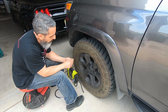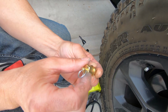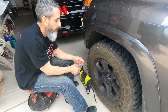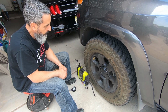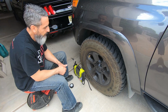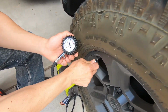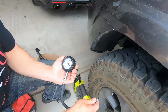So I'm going to loosen that set screw again. I'm actually going to turn it the half revolution. I'm thinking that's going to take me down to a little over 19. And then I'm going to turn it another quarter. I'll snug up the set screw, and let's see where we're at here. Okay, there, stopped. PSI 18. Let's check it again. 18. Oh, actually, we're just over 17.